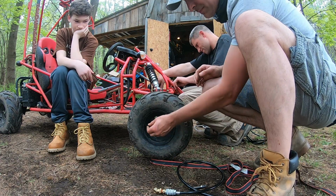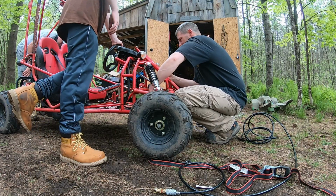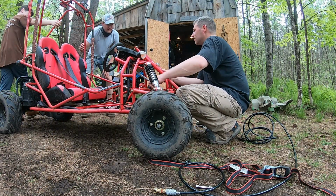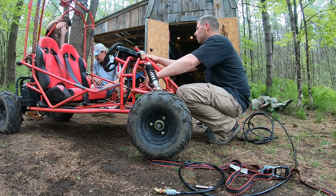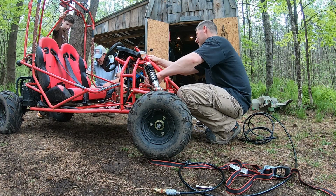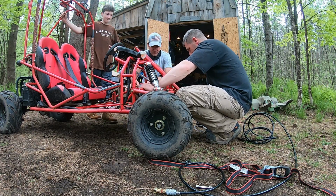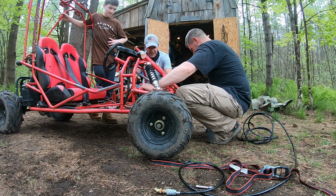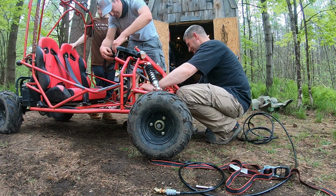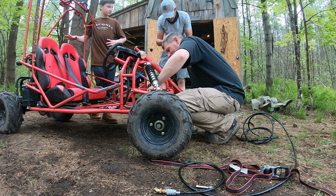Boom. So now, one question: is the rear brake system separate from the front brake system? You could use the handbrake, but this disc feeds up to the same reservoir. So all the brakes are connected there. So I'll have to fix that, or we will be going and not stopping. But it looks like everything else is good.